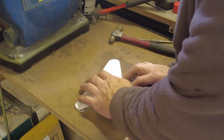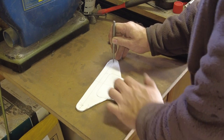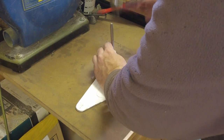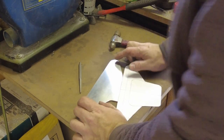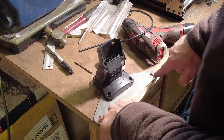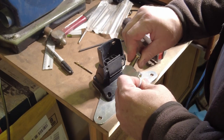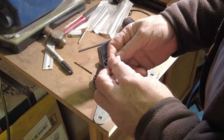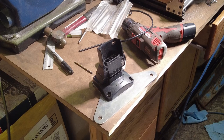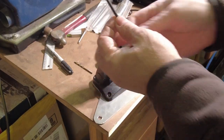Here's our aluminum mounting bracket and our template laid up on top of it. Put the tip of the center punch on the crosshairs, make sure the rest of it is reasonably well lined up. Now I'll get a drill set up and drill those holes out. So I've got the holes drilled that will eventually attach these brackets — unfortunately, silly me, the bolts that I got were fine thread, and in 10mm there are three threads available, but these appear to be the medium thread. That's not going to work. But we can still continue to drill holes to mount the GPS.